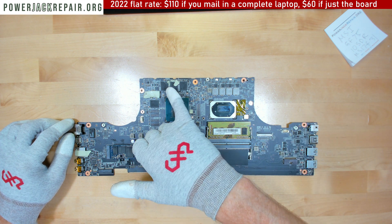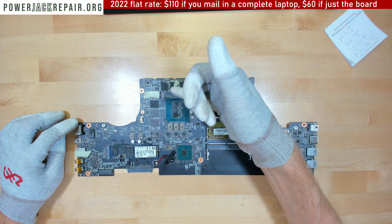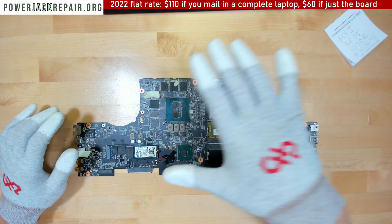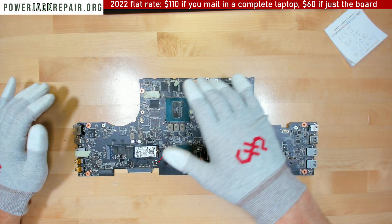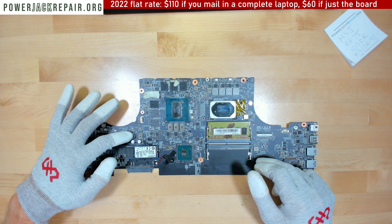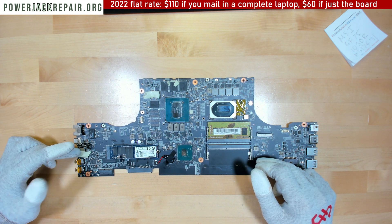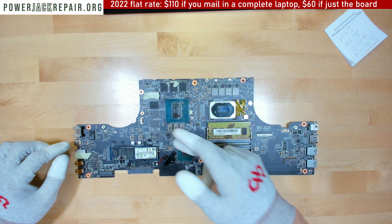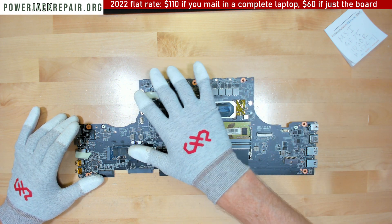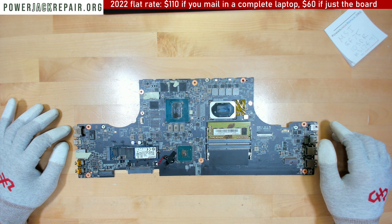One point of advice — you see those pads right here. Before shipping out just the motherboard, make sure those pads you're going to put back onto the heatsink, on the bottom side of the heatsink where you took them off. This pad is definitely not from here; it's from someplace here or here or here. That's how we received it. This pad should be here someplace, and when you assemble it back together make sure it's not double stacked, because if it's double stacked then the nearby components won't be cooling down as well.